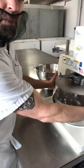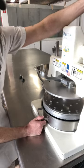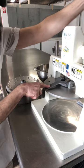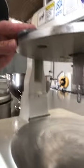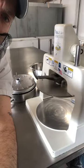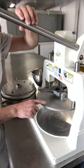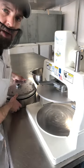So slide it in here and pull it forward a little so you can see. So this has a plunger inside. Let me take this out. You can see if I push this lever down I can pull — see the little plunger coming down? That's what's going to grab on to the head. I'll just remind you that every little thing here is a pinch point. If you pull this down with this heavy metal plate and then push this plunger, this will snap up, and if your fingers are in there it'll break your fingers and maybe squash your hand. So you don't want to do that.